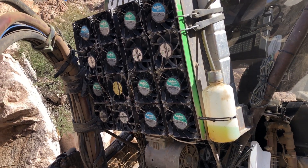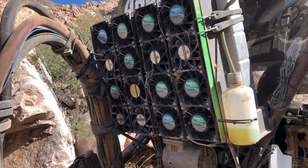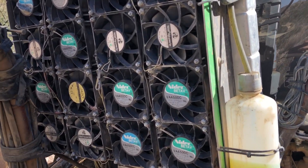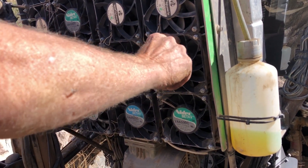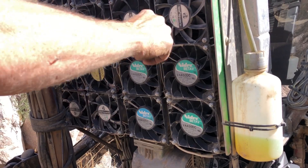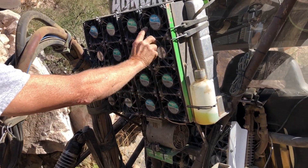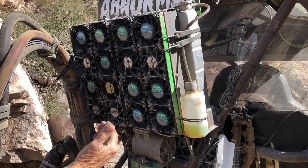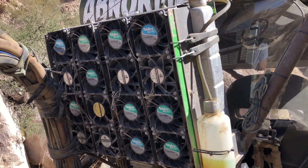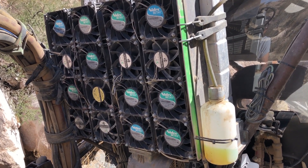There are lots of questions and comments about these fans. I've run them on four or five different cars I've built. I like them because they're from Surplus Center — they're cheap, about four to five dollars a piece. They're rated at 2.5 to 3.3 amps depending on which one. For a little fan, they move lots of air. They're much more industrial than a computer fan, but similar.